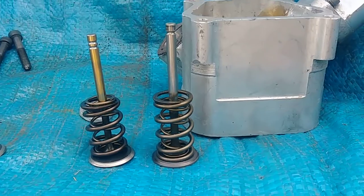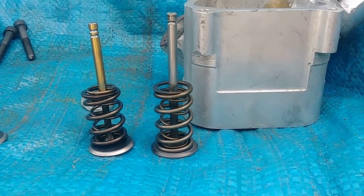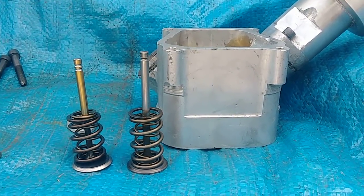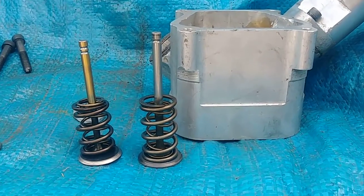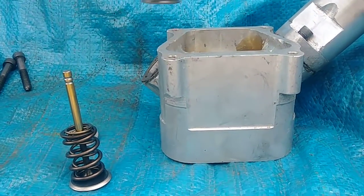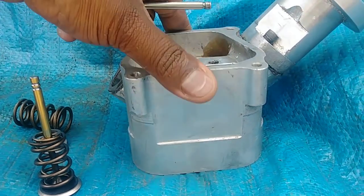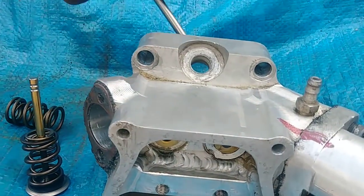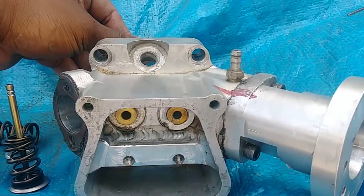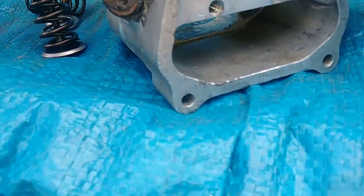The spring is set up to be installed at, what is it, a 1.200 installed height. So I've got about 65 pounds closed right now. I don't plan on changing anything, but like I said, I'm running about 550 lift in this head. What cam will it be? Actually, I think I'm running a 400, or I'm not sure, was it a 380 cam in this thing?